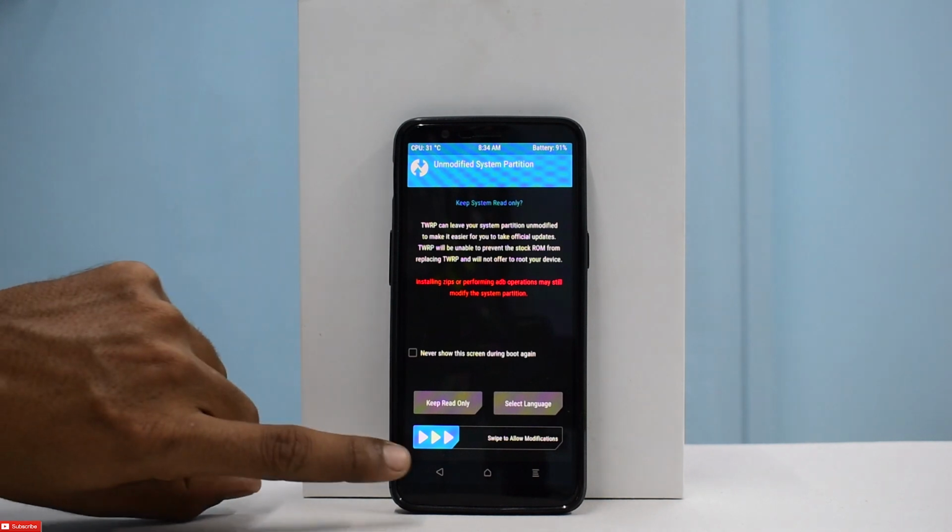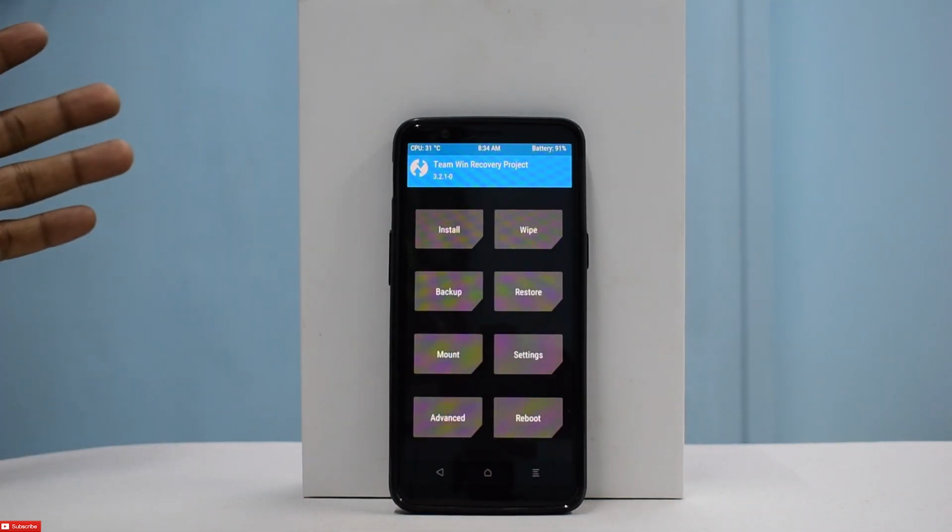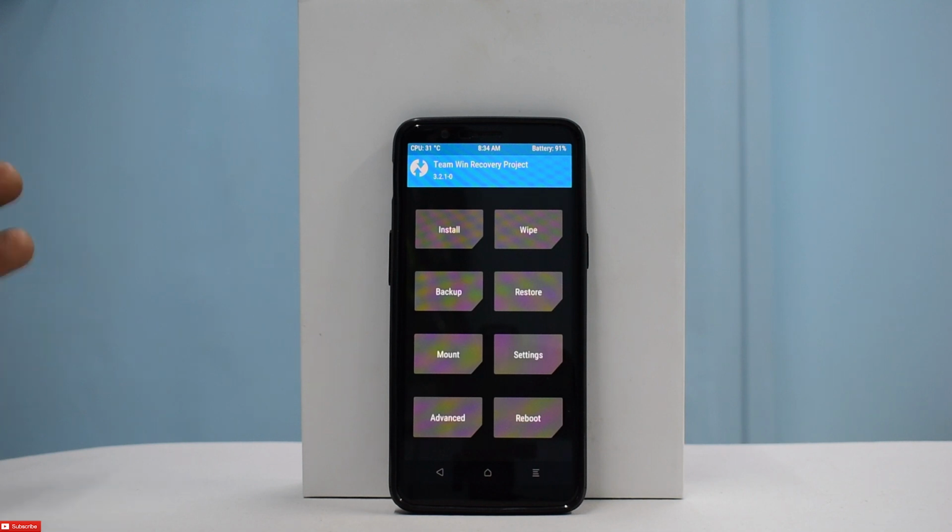Another day, another video about an install and preview of a ROM for the OnePlus 5T. Now, this took me a while, not to get this particular ROM, but to get this ROM to boot on my phone. It was on stable Oreo, and I wiped everything on the internal storage and tried everything possible, but it refused to boot. So finally what we settled for is I went all the way back to 4.7.4 using the unbrick tool, unlocked the bootloader, installed Universal TWRP by Codeworks, and without wiping anything, I flashed Resurrection Remix Nougat, and bam, it booted up.